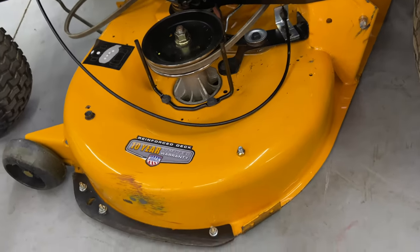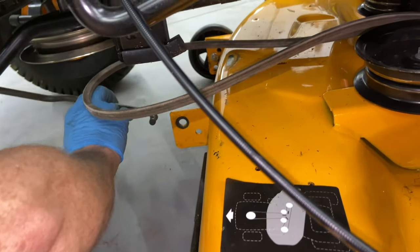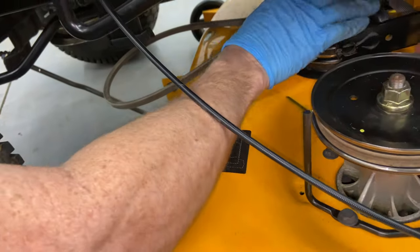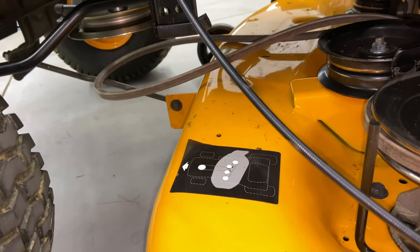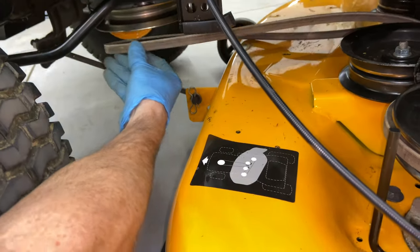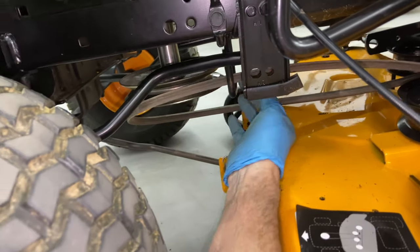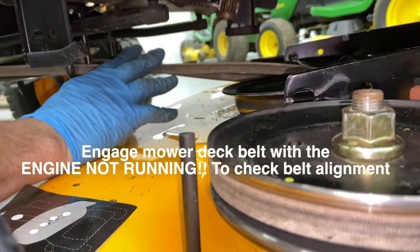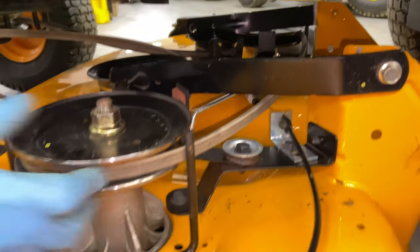I'm going to start by putting on the front bracket first, which is right here. As you can see, we're about three inches away. The parking brake is on so the mower doesn't move easily — I'm just going to pull the mower deck forward a little bit and then it'll slide right in. Go ahead and put your washer on and your clip in. Now, we're going to put the mower deck belt back on. Remember, there's a U-bracket here — you have to put the belt above the first little U and make sure it's in between. When you put it all back together, make sure you engage your deck to verify everything's running correctly and all the belts are in the right alignment.